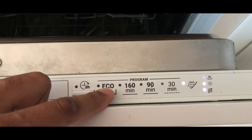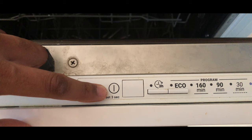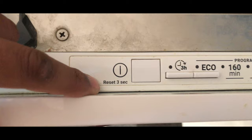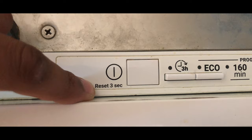The last option is the washing mode with rinsing, and the last button is the reset button. This is an important button — if anything gets clogged or something happens, just press and hold the reset button for three seconds. Close it and you can see all the water suctioning back into the pipes — you can hear that happening. After that you can use it normally. That's mostly what's important — thank you.